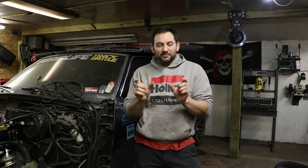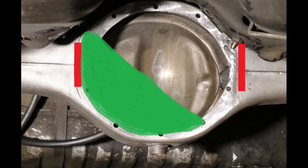And that kind of makes sense, because then all the bearings would still have had a little bit of lubrication holding on to them, and they would have survived just fine being dry for a little bit, but the gear faces themselves would have been completely dry of lubrication at that point and then continuing to build heat and wear. So thinking about that going forward, I'll have less of that to worry about, because now with the floater rear end that I'm putting in, that will be greased bearings on the outsides, and I actually have some inner seals in order to keep all of the fluid right in the center diff section. So actually, this problem should probably solve itself with the changes I'm making.